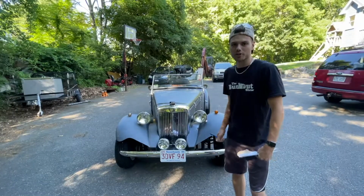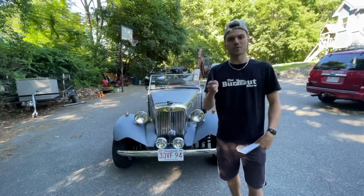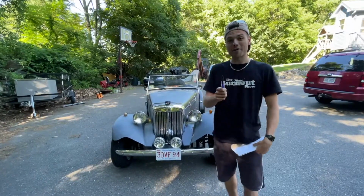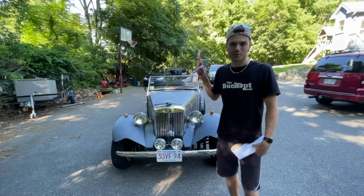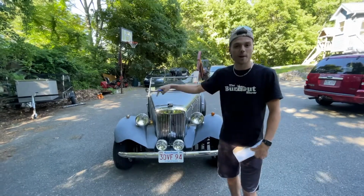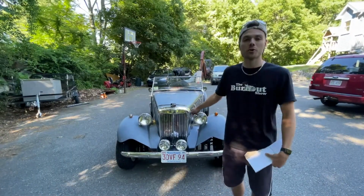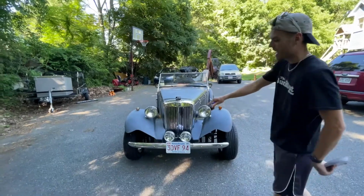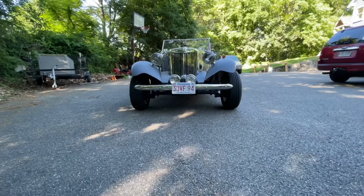So next time you hop in your modern car and you think it's easy to drive kind of left to right, or you hit a bump and your car comes out of that bump straight, that has to do with your wheel alignment. And on this car, it is not aligned at all. As a matter of fact, if I brought it to a shop to align it, they would probably tell me to get out of their shop because it's such a hassle to align one of these cars. And by that I mean, it's really not that hard. You actually have to tighten or loosen a couple arms that go across, or the sway arms, when you steer. However, it is so rusted and so old underneath this car because it's an old Volkswagen that they definitely wouldn't do it. So take a look at this car, I'll step back, and you can notice that it's truly just not aligned. The tires face slightly out on both sides.